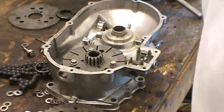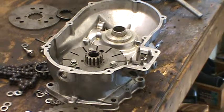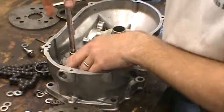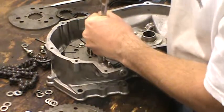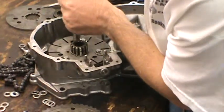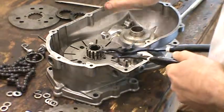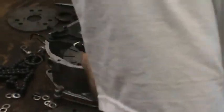Alright, so I ran out of tape last time. I got some more memory for this video camera so we can finish reassembling — I know we missed a lot, but hey, what can I do? So I'm just going to take this apart so you can see how it goes together. I'm using these threaded screws to compress the clutch plates — pressing down, squeezing the spring plate and the clutch plates together. That way I can relieve the tension so that I can get this circlip — a retaining ring, whatever you want to call it — off.